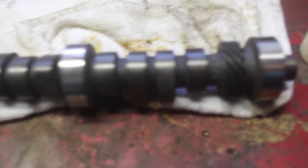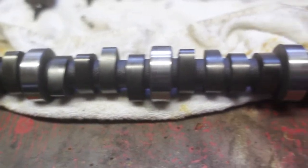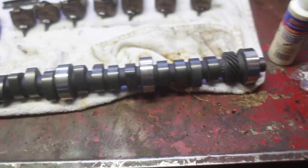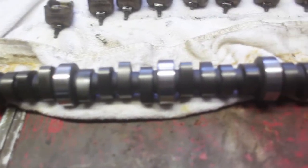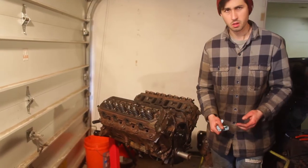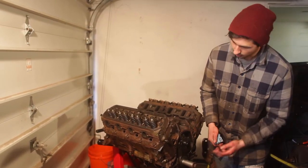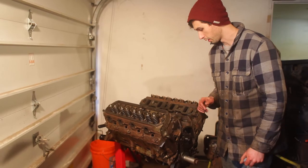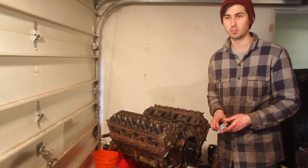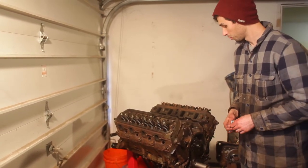We got our new cam — it's an RV and truck cam, supposedly a stage one cam. I didn't look too much into stock specs versus what this thing is, but it's supposedly usable with no upgrades, has a good idle, so I don't expect any power gains but I don't expect any drivability loss either. We got the cam all lubed up, tried to coat all the surfaces that make contact with assembly lube, and it just slides into its spot. Tapped it in with a mallet to get it seated all the way into the bearings. It definitely helped that it was sitting out on the porch at 14 degrees outside — I think it fit into the bearings a little better.